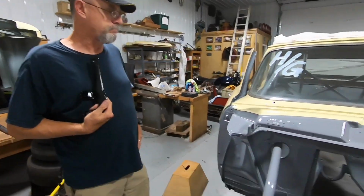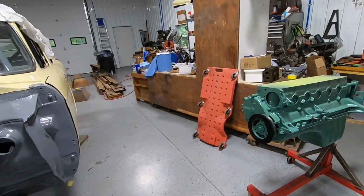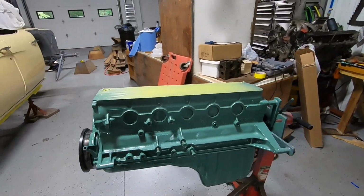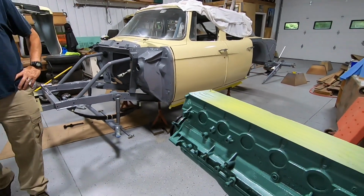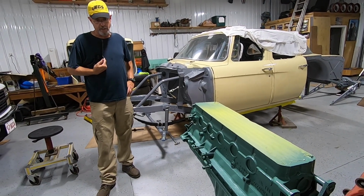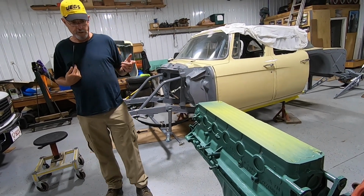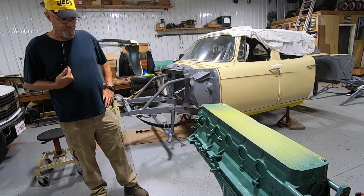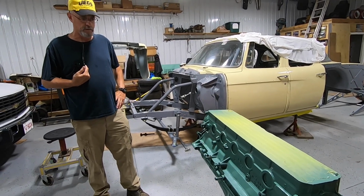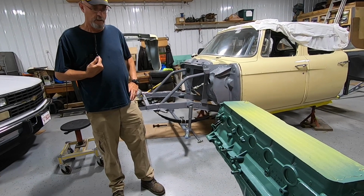And you'll be running what kind of engine here? I'm going to be running a 4-liter, essentially an AMC Jeep. It's the same engine they made from 1964 to 2006. Made them forever. 251 cubic inches. It's a 60 over, what everybody knows as a 4-liter, 242 cubic inch.